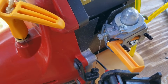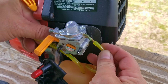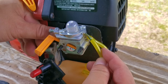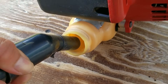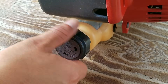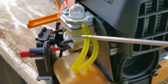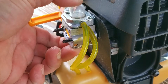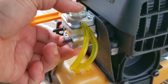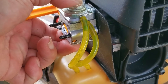After cutting the fuel lines to approximate length, I'll then reconnect the throttle cable to the carb and then slide the carb back onto the studs. On this particular carb, you need to adjust the throttle cable's anchor, but on most other brands this is not needed. After checking that the throttle is working like it should and not sticking, we'll install the fuel lines. On this particular carb, the fuel filter line will connect to the lower port while the return line connects to the top port. After putting some fuel into the tank, we need to confirm fuel flow through the system before we try and start the engine, otherwise there's a good chance that the engine will not start. So when pressing the purge bulb, fuel will come up the filter line into the carb, partially fill the bulb, and then leave the carb through the return line and back to the tank. After pressing the bulb several times, fuel has finally started to leave the carb through the return line, which is exactly what we wanted.